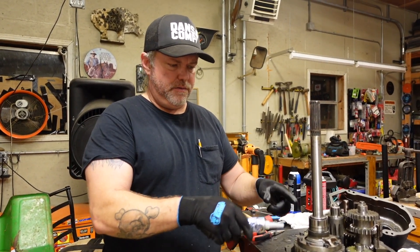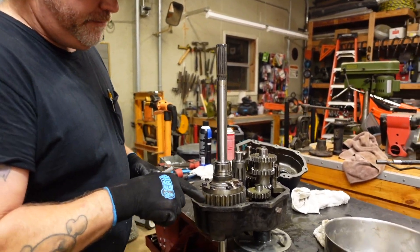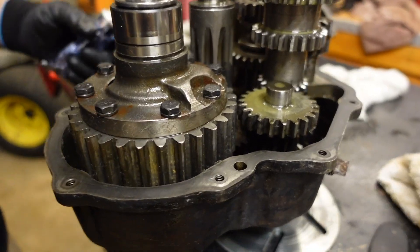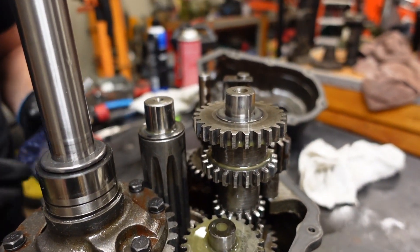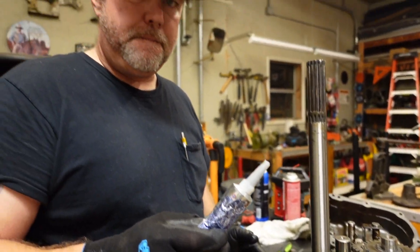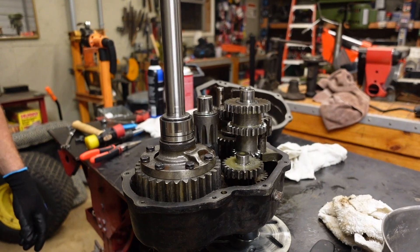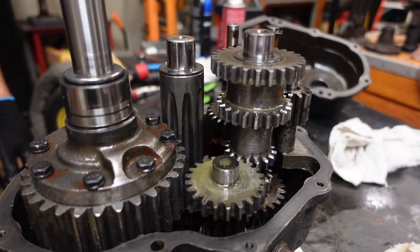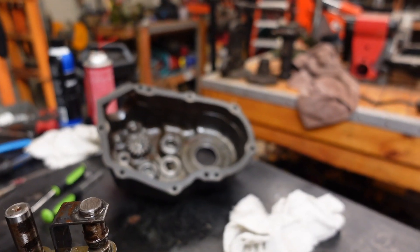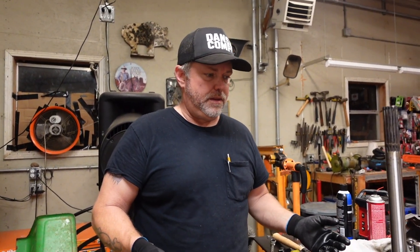The axle's locked — the differential spider gears are all welded up, everything's ready to go, and we got it back in the case. The old gasket basically came apart when we split the case halves, so we scraped off the old gasket material — came off real easy — and we're just going to put it back together with some RTV. I wanted to give you guys a quick look at what it looks like inside one of these things in case you weren't looking at the other video I linked.